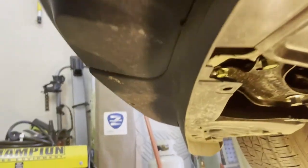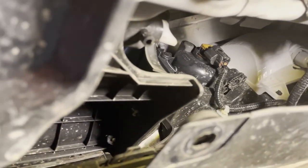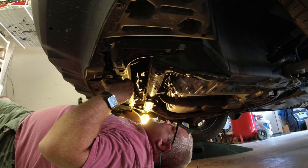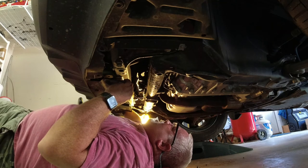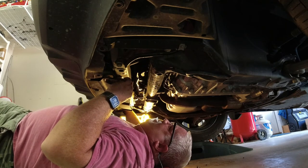So at this point we've taken out the piece — this is the panel we were removing. Now when we get up inside here we can look up and see our fog lamp right up in there. There's our connector right there — you see that little orange piece? That's where it disconnects to change out the bulb. You reach way up in here and disconnect the electrical connection. There's a push button on the very bottom — push on that and pull down to unplug the electrical connector.